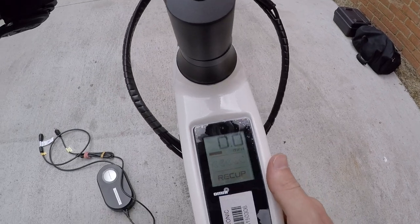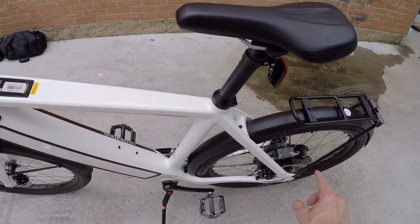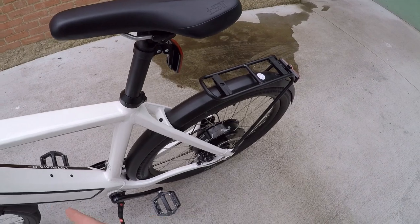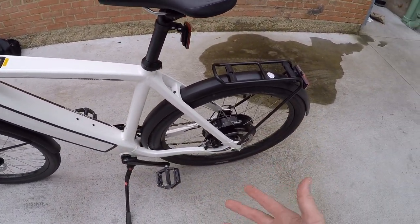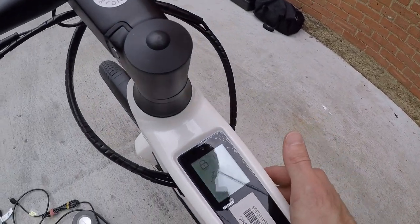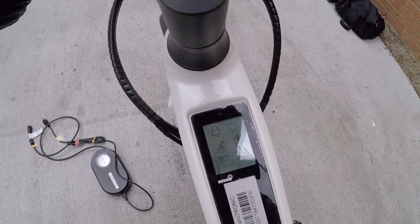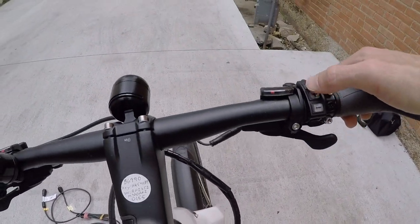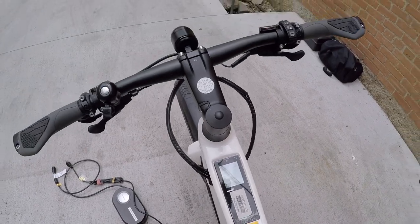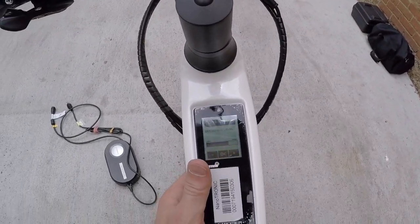Back into the menu: pressing the main button brings up all the menu options. 'Lock' basically uses the battery to set the motor in a really tough regen mode so you can't pedal the bike away efficiently — it's like a cafe lock built right in, but you need a PIN to unlock it. 'Move' is basically a walk mode: press it and use the plus button to walk the bike. 'Sensor' lets you set the torque sensor higher or lower depending on whether you want it really sensitive or want more of a workout.